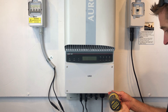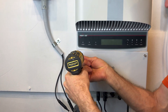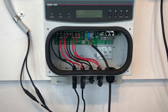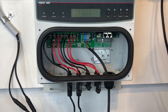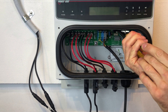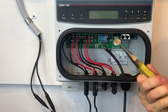I'll just start taking the cover off now. So up in here we have the little button battery in its holder. What I recommend doing is with a pair of long nose pliers, grab it on the right hand side — you should be able to lift it up a bit and then pull it out like so.